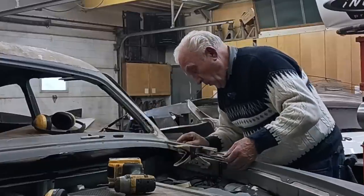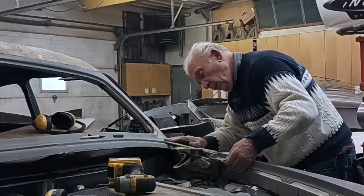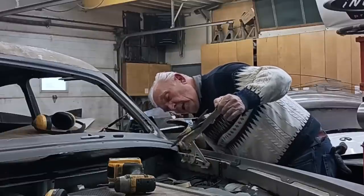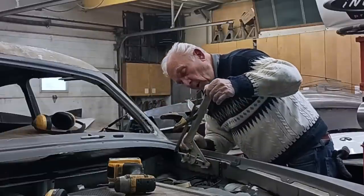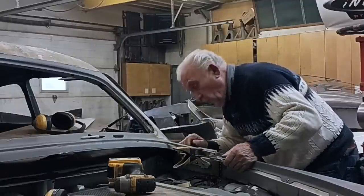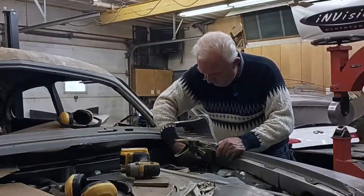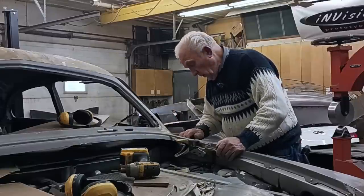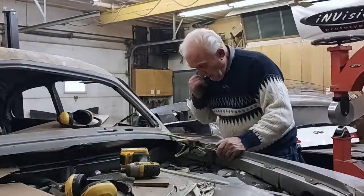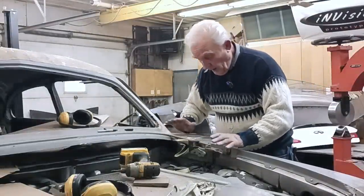Let's see how it works when we open. That's flush with the surface of the hood there, with the fender. Up it comes — and we've got adequate clearance at the tail edge of that hood all the way up. That worked out quite nicely. So now we can scribe where the actual holes are going to go, drill them, and we'll probably put weld nuts on the back. The fender will come off and weld nuts go on the back — and that hinge is done.